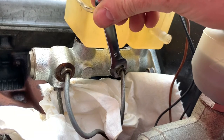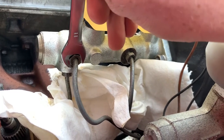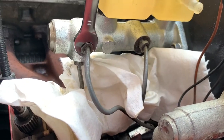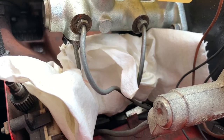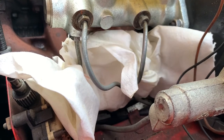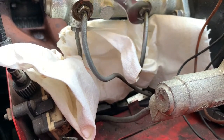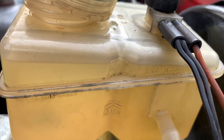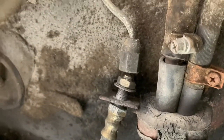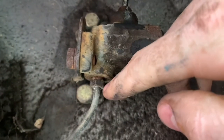I had expected the fluid level to drop overnight. I left the cap unscrewed on the reservoir so that it didn't create a vacuum and I wanted the car to gravity bleed. This should only take about 15 minutes, but it was getting dark and I didn't have enough time. I came back out and the fluid level hadn't dropped at all. I double checked each of the ports and was getting fluid perfectly fine. On the rear brake lines there was no fluid reaching the caliper, so I knew I had an issue. The front lines were basically fine but it was very low fluid flow. This brake line is completely dry, but I cracked this line and it's wet. This line is also completely dry.